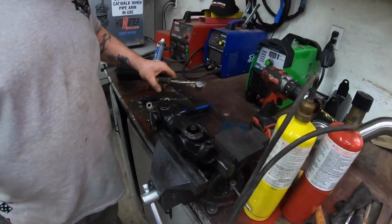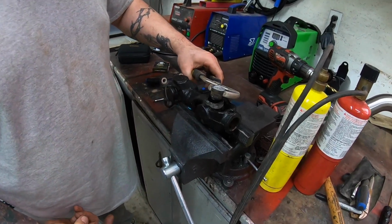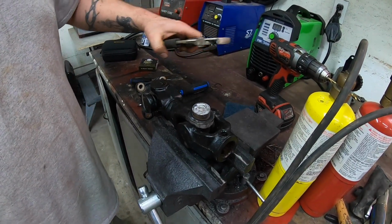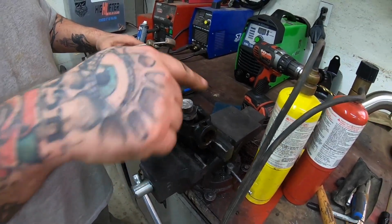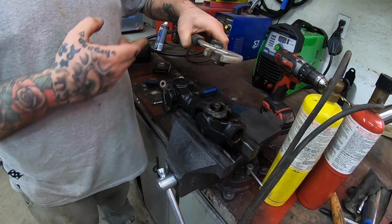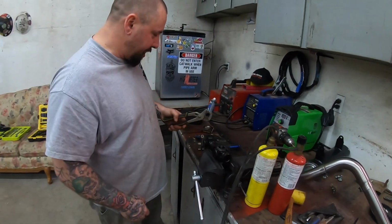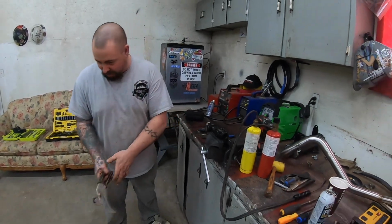What we've done is you want to press the cap up to a point where you can grab it. So we'd press it this way, then we took some heat, heated up all the grease, freed everything up, and then with a pair of channel locks, pulled the cap. Now that the cap's out, we can push it back down and continue to change the U-joint just like normal.